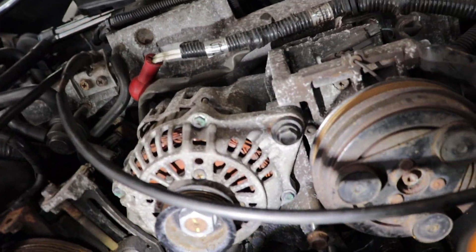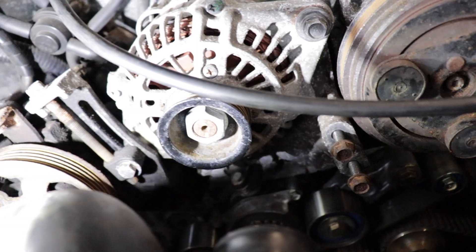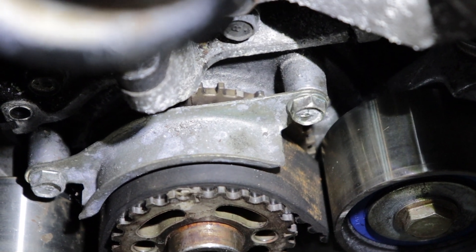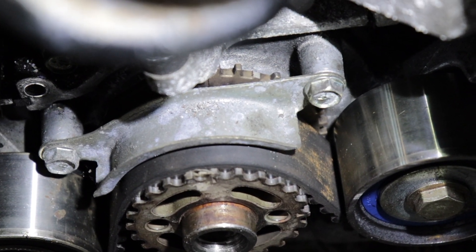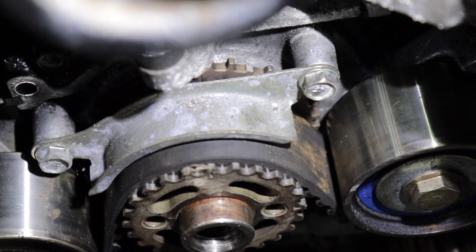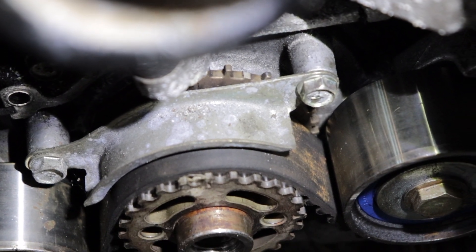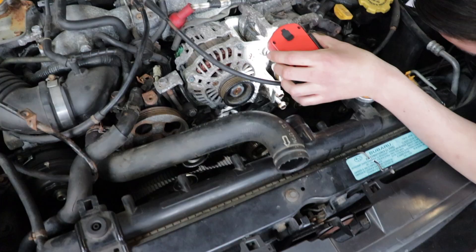The next thing I'm going to do is check timing to make sure it's actually in time, because if it's not in timing it definitely won't fire. We've got it at top dead center now and everything does line up, so it's definitely in time. But look closely at the sprocket down there — it lost a tooth, like a little baby child losing a tooth. That will definitely cause issues, so either way that sprocket has to get swapped. I'm going to take the sprocket from the silver car and put it on here and see what happens.